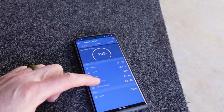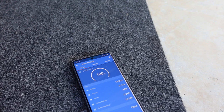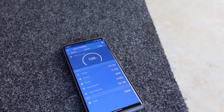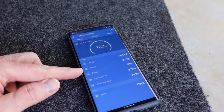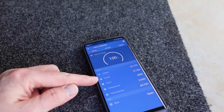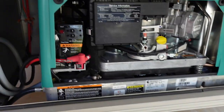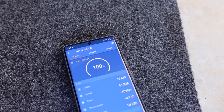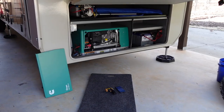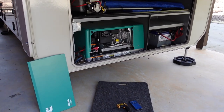Back on the battery monitor, we're still at that negative two amp idle draw with the BM Pro system running and the inverter with no load. We're going to start the generator again and pay attention to the current number to see how much less amp draw it is now that the generator is warmed up. This second time, it peaked right at about 87 amps with the engine already warmed up.